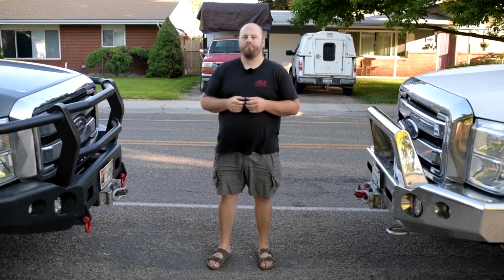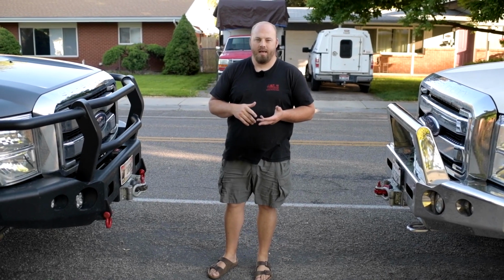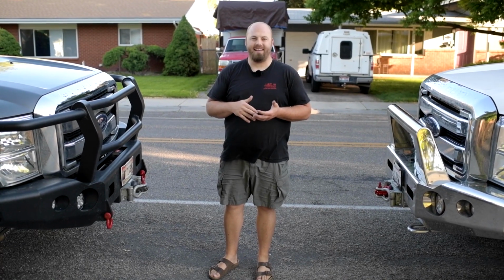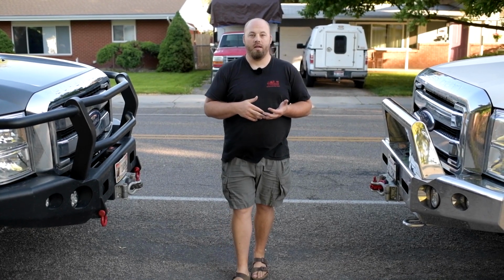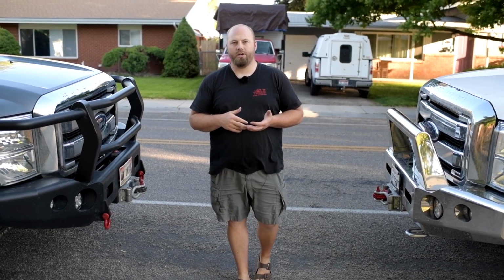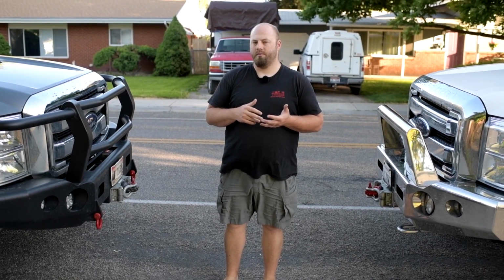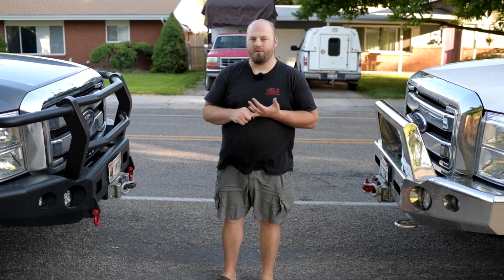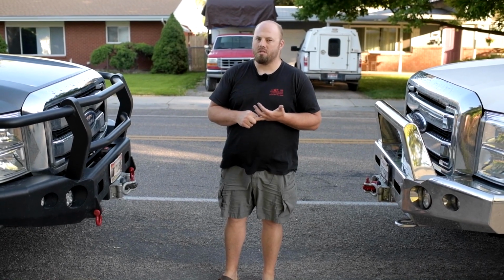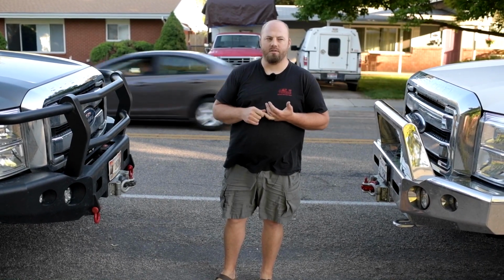It's all done. Okay, if you use a winch or you want to get a winch, always make sure to check your cables. You know, maintain them, clean them off, and check them for any wear and tear that might get you hurt when you actually need them. Get a good link system, Factor 55. Makes a great closed link winching system. Also, if you're going to use shackles, make sure the company whose shackles you get has a quality control system that's actually checked and tested. So again, I use Crosby shackles and everything like that.